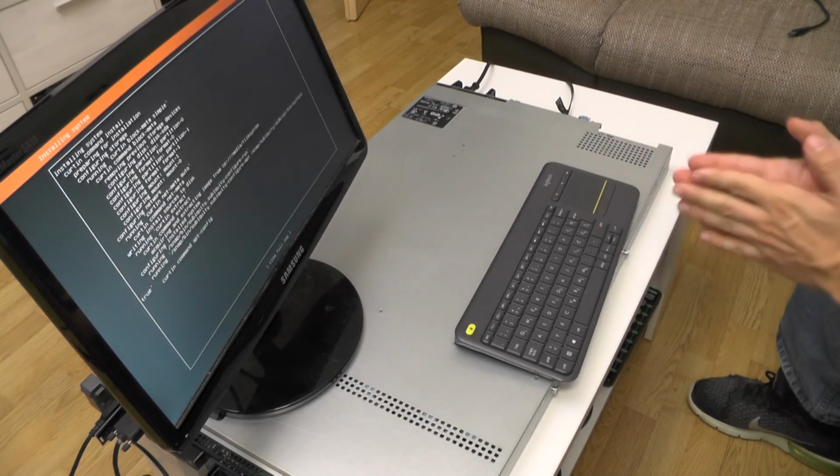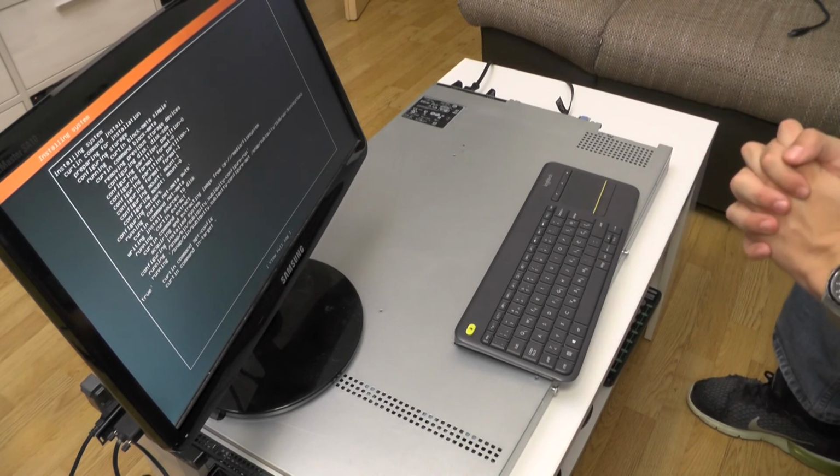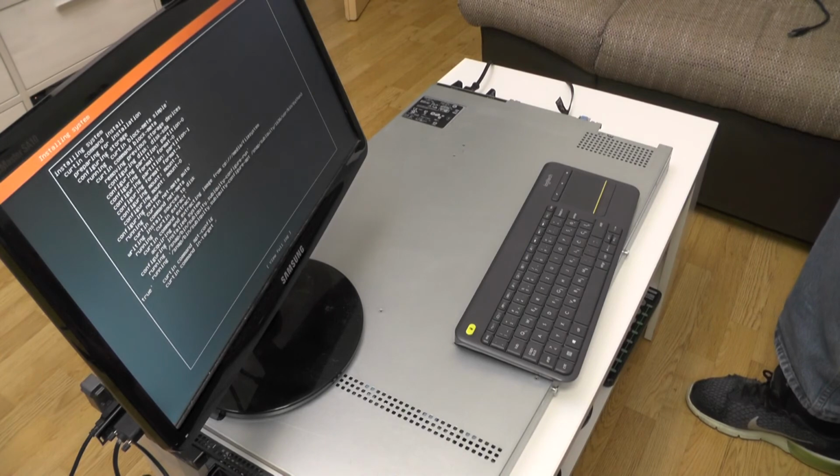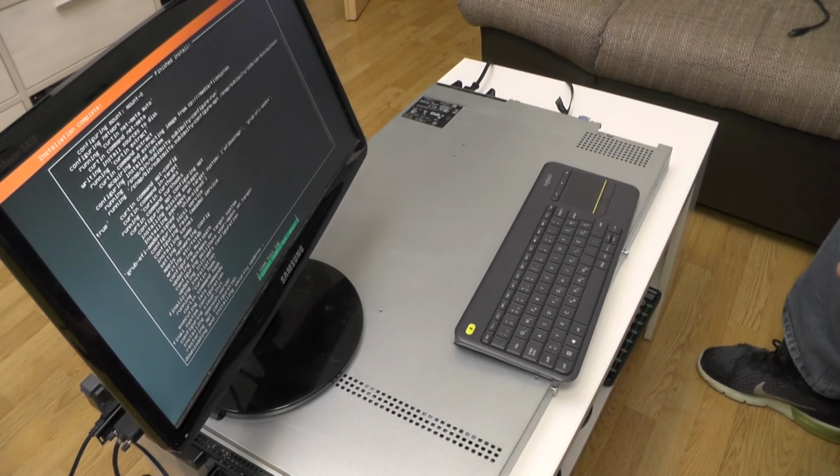As you can see, it's copying from the USB drive, and let's see how long this takes. Or will it fail? The installation is now finished, and it's downloading and installing security updates, which is quite a nice feature of the installer. You don't need to do this, but you can. If you cancel this, it will reboot immediately. If you don't, it will take a bit of time, and then you will have less to install after the computer reboots.